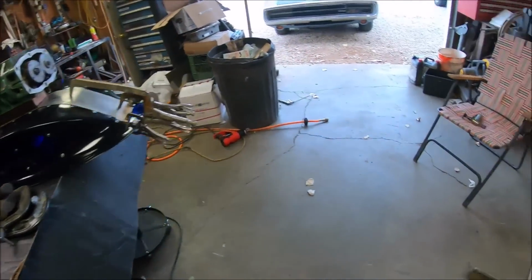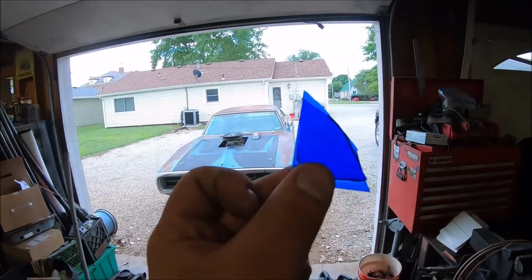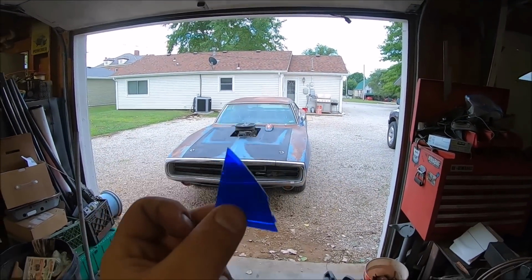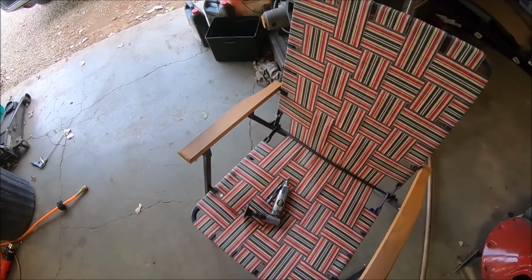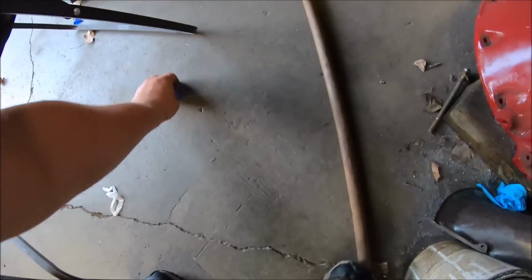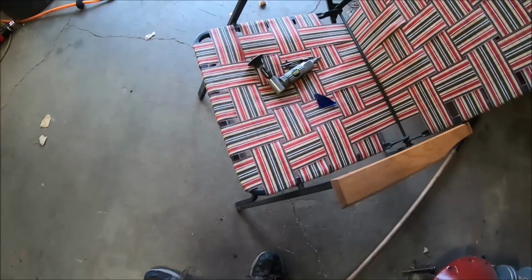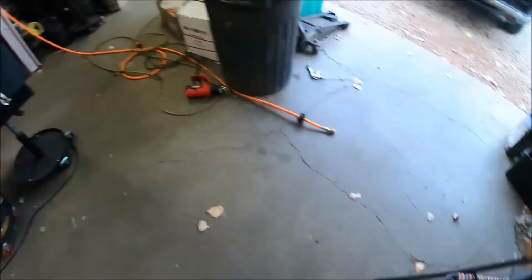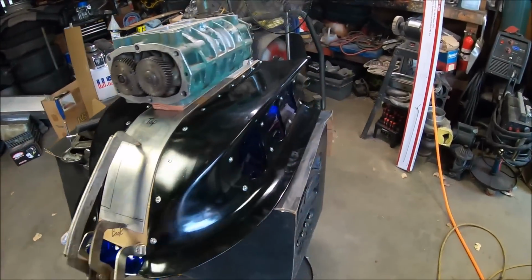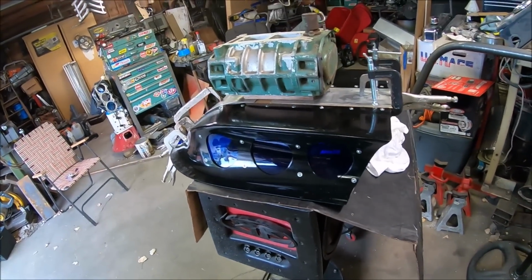I did a test to make sure the scuffing wasn't going to affect the visibility, and it's still pretty damn clear, just really dark. In fact, that one's already set. This epoxy here is like 5-minute epoxy, but it's supposed to be cure time in an hour, and it cures in like 20 minutes maybe. The problem with those 5-minute epoxies, they say it cures in 5 minutes. In reality, it's like 2 minutes. Always about half the time or less.